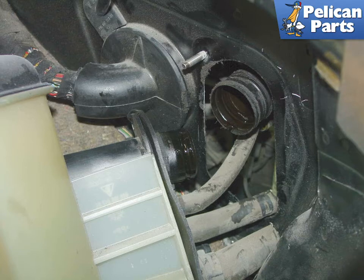For this photo, I was first able to disconnect the filler hose and then I had enough room to pull the tank out to reach some of the other hoses. You can also push the DME wiring harness grommet into the engine compartment and gain some additional access that way.